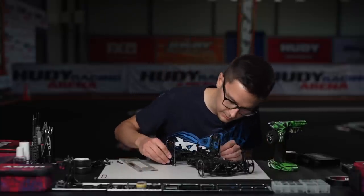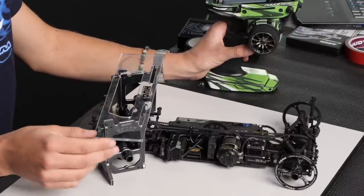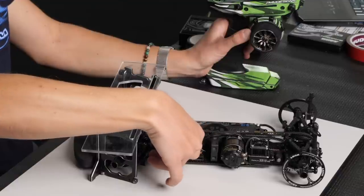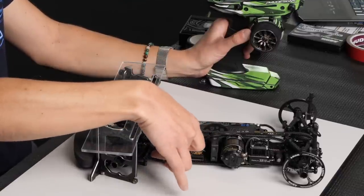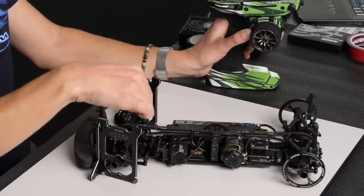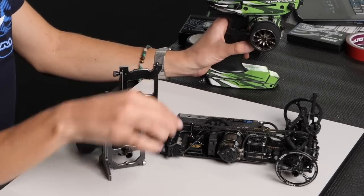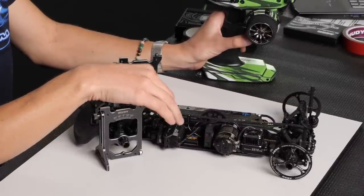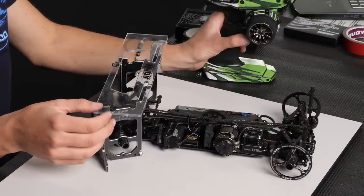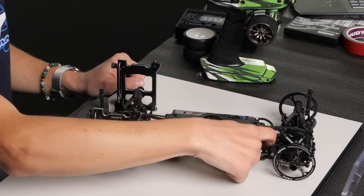On this car, since I removed the shim from the center of the steering, we can reach 28 degrees of steering lock per side. It's perfectly equal and the steering link is moving freely at full lock, which means it's not binding up. If the steering link is not moving freely, the steering is pushing against the steering arm and will bind up during cornering, having a negative effect on the flex of the chassis in the front. The toe is now perfect, steering lock is 28 degrees — everything is square and equal.